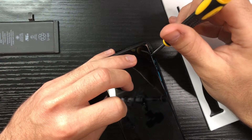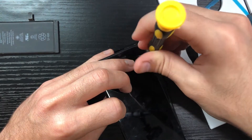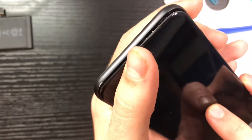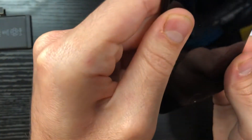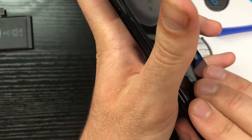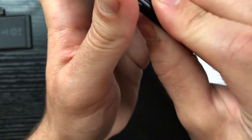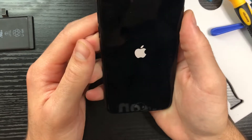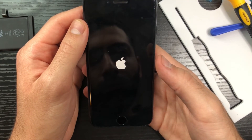I had a problem with the speaker panel screw on the inside — working at a different angle helped a lot. Then you're ready to place the LCD screen in: angle it so the top part slides into the case, and once it slides in, click everything down and gently press it down. My screen was popping out a bit — press up and down a little. Placing the adhesive on the case rather than the LCD screen first might have been better to avoid it catching on the pins, but it worked out fine. Close the phone, screw on the bottom screws, and turn the phone on.